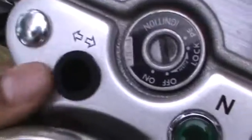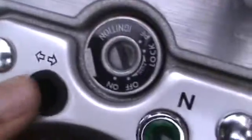What you're going to need to do to take off the indicator is get something like a flathead screwdriver and kind of pry under it a bit. You might even be able to do it with your nail, but you might find it's too tight. So what you'll have to do is — see this little rubber piece that sits under there? You're going to push it up as much as you can. That'll loosen up the lens so that you can take it out. You're going to take that lens out and then pull it through. You can work it over to the other side — just kind of pushing it through there and pulling it a bit. I have a little bit more room to work with when I've got it on this side.